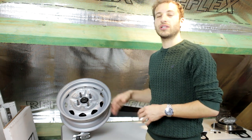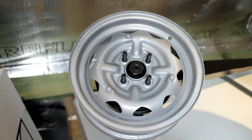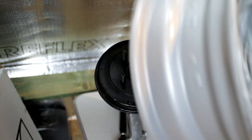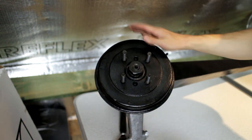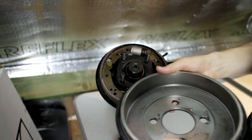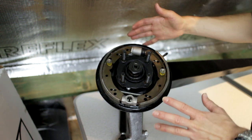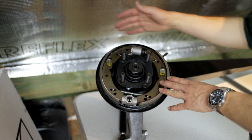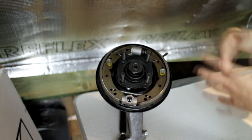To start off we'll take a look at the original brake setup. This is an original steel wheel. These are drums — new drums but completely original style. So cast iron drum, quite heavy. Now we can see the internals of the brake drum. These brake shoes have the original size and original shape. However, the braking compound on here is not original — this is a competition lined brake shoe. This means it's less susceptible to fade and better to use on a track day or on a rally for competition use.